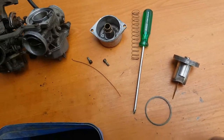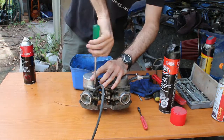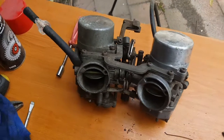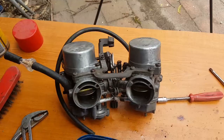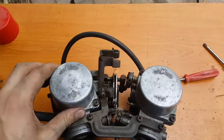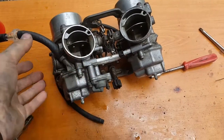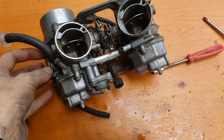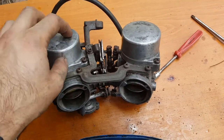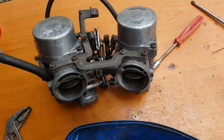Time to put it all back together. One carburetor out of two is clean. Now through the magic of editing — done. Both clean. I just repeated the same process for the other carburetor. At the same time, I cleaned up the tops just to make them a bit more shiny. If this was a proper full rebuild of the carburetors, I would have pulled them completely to bits, cleaned every separate component, and then put them back together. But I'm only looking at doing a quick fix just to get them working again and put them back in the bike. At some stage I'll put some graphite powder back in the top — that should help them slide. Newer carburetors will have a rubber diaphragm; these older ones just need a bit of lubricant to keep going. Time to put them back in the bike.